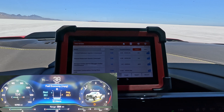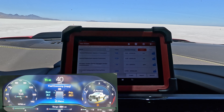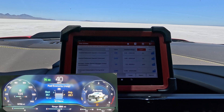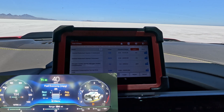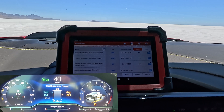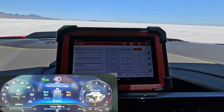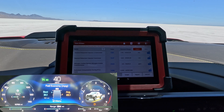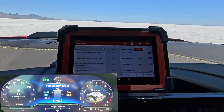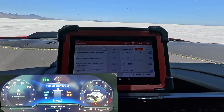Total reductant used is 0.004. Cruise control set at 40 miles an hour. We're already getting some readings. At 40 miles an hour, you can see reductant injector command — that is number one reductant injector. There are two on this 3.0 Duramax diesel, and we're sitting at a steady 15 to 16 on consumption. It is injecting into number one only, not number two. We can see our NOx concentration. It looks like we're sitting at a solid 17 at 40 miles an hour.